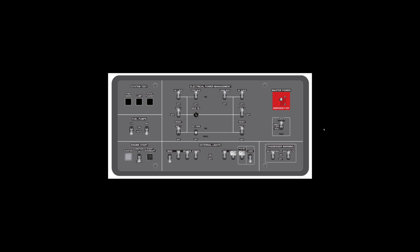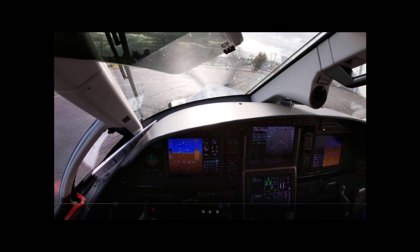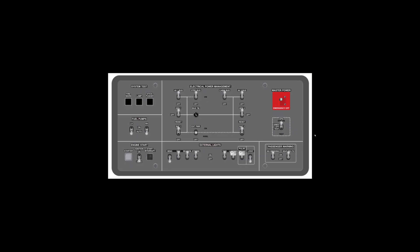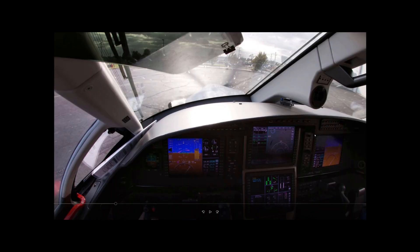The first thing we do when we get in the airplane is we actually test the EPS. The EPS is there to provide emergency power in the event that we lose all other electrical power in the airplane. So if we have a dual battery and dual generator failure — which means we're having a really bad day — we've got a separate independent 24-volt lead-acid battery that sits below the floor in the passenger compartment, just inside the door on the right. It's completely independent of the rest of the electrical system and it powers the EPS bus.